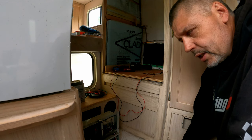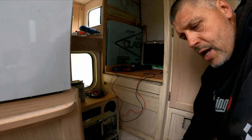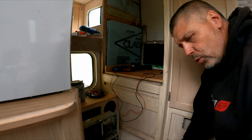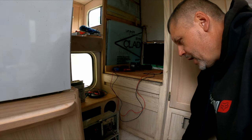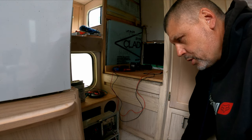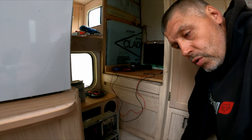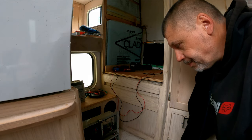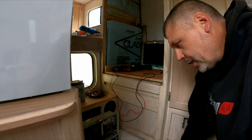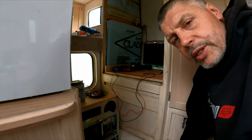I noticed when I plugged in the electrical system the converter wasn't making very much power. I put on a lower charge battery and the output was poor — it's the original converter. I was going to use it since it would still charge lithium batteries to about 90 percent, but it's not working well so I'm not using it. It's a 25 amp factory unit, so I bought a 40 amp lithium charger to replace it — whether it fits in the same spot or I have to put it somewhere else, I'll figure that out.